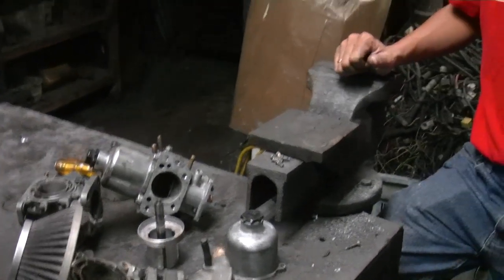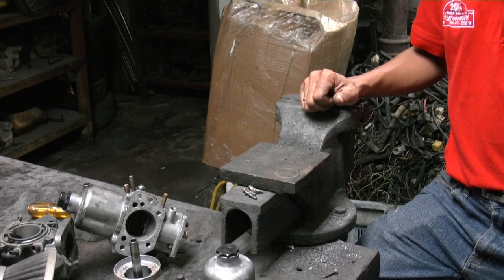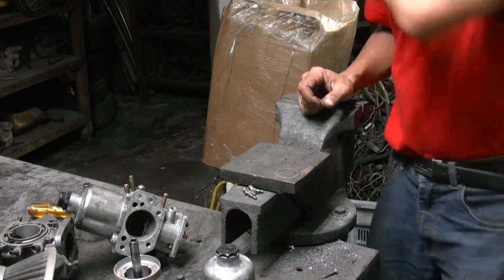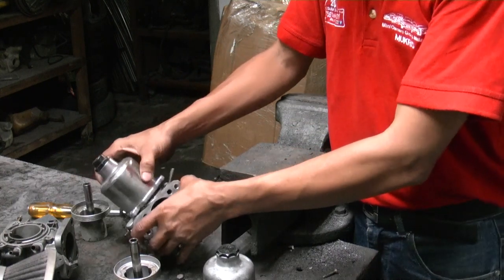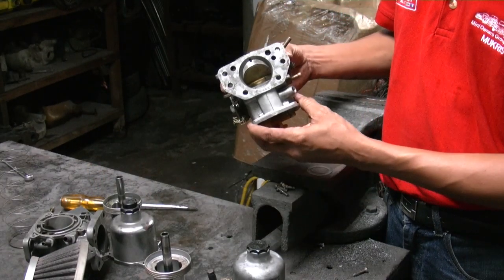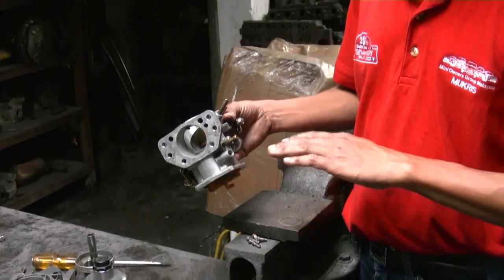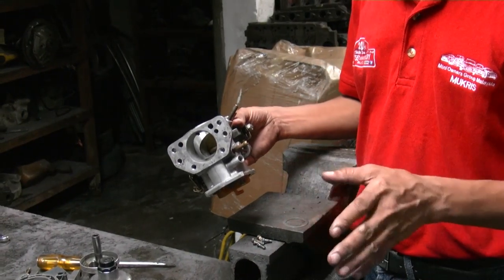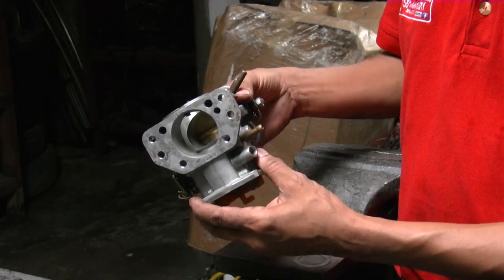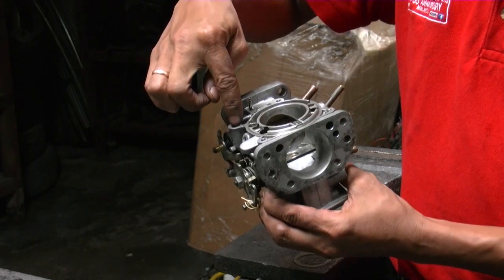So, coming back to the gentleman's question about setting it up, can you give any advice on how he should perform these adjustments? Firstly, you have to get the car running. Once the car is running, let it idle until you get the right operating temperature, and then you set it up to about 1000 RPM with the idle screw on top.